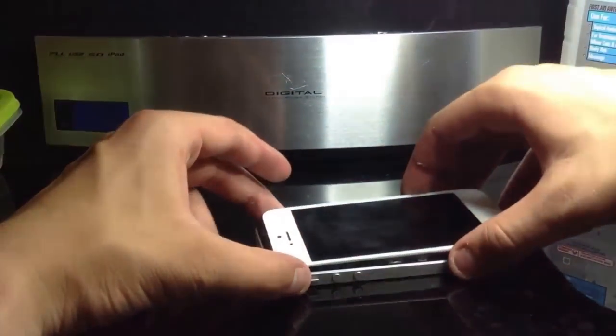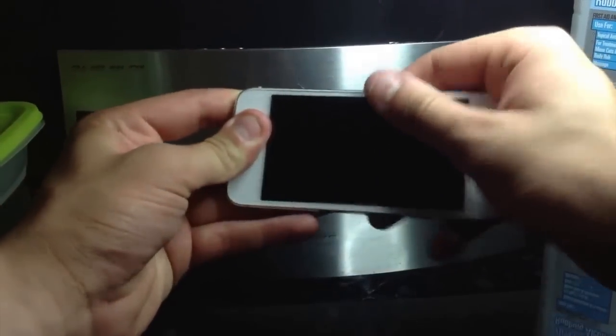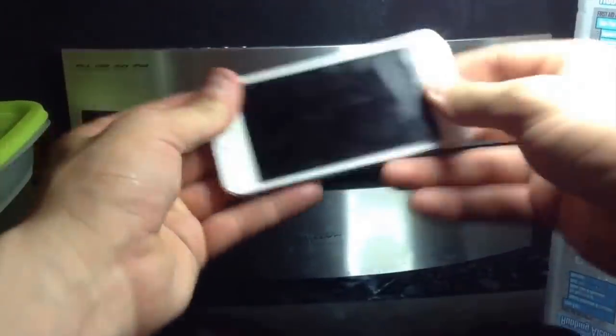When you put the shield back in — this is the last step before the front assembly — put these little hooks along the motherboard just like so, make sure it's flat and stable. We're going to put these two front assembly screws in first — this one is not magnetized, it's the last screw we put in before putting the phone all back together. For the non-magnetic screw, just drop it on there then push it over and screw it in. Now go ahead and install your front assembly: digitizer first, LCD second, and camera front assembly first. Wipe down the LCD and give it a little blow. When you put this assembly back down, put it top-first, then push it down — ease it in carefully so you don't bend your LCD, because that'll cost you about $160 for a whole brand new front assembly.